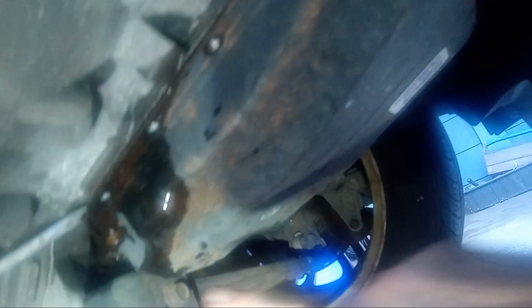And so it doesn't just fall off. And so the reason why you leave these four corner bolts is because you saw what was coming out. All right. And so that's a bunch of fluid in there. So you got to let it drain out slowly. Now there's probably more in there so I got to drop this even a little lower. But when I broke just the corner there, I slightly tapped it there just to make a gap.